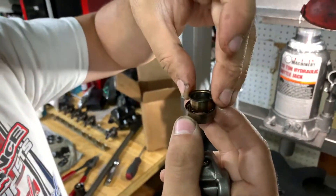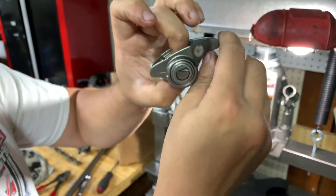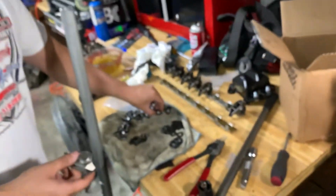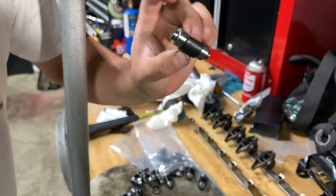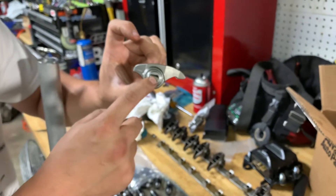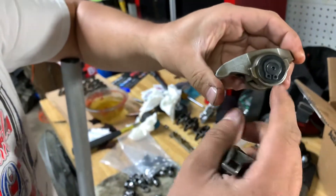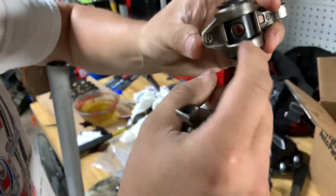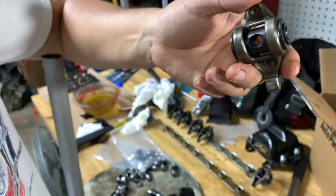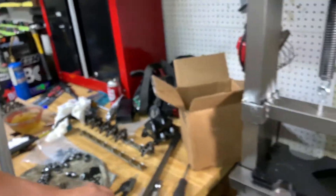It is two pieces, and that's how it allows the rocker to function. To upgrade these, there are companies such as BTR, which is what we'll be using today. This is the BTR version 2 trunnion upgrade kit. We need to take the old portion out first so we can put the upgraded trunnions in — and then it'll look like this, with a c-clip and a washer, but the needles are actually trapped and captured inside that cage so they can't come out into the motor if anything fails.